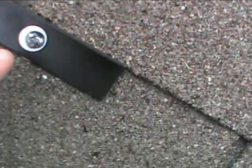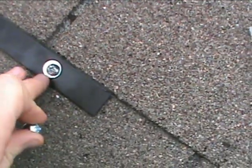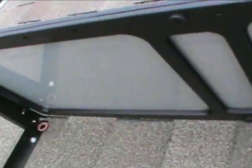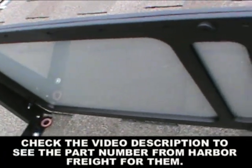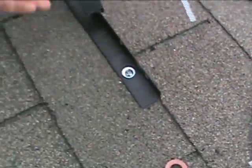We've affixed the first solar panel to the roof. The process was: screw with that washer through the metal frame, with the O-ring underneath — so it's sealed good against the roof and won't leak. Now we're going to take our frame and, depending on where you're facing the sun, some people may not even need these frames. They make just the little mounts that go underneath the frame itself to screw to your roof. If your roof is perfectly on the plane with the southern sky, you're fine. But if you're like me, I'm not exactly right on the money, so to accommodate for that I've got these mounting frames. I've adjusted it right to where I need mine.